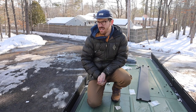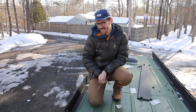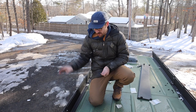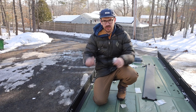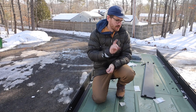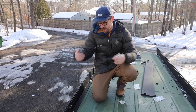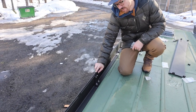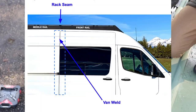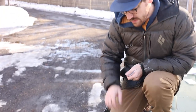Progress update: we've got the front fairing on, the sides are all loosely bolted down so we can still adjust things. A very important alignment tip — at least with our van — is this front seam, which should line up with the weld line on the outside of the van, which happens to also be the back side of the sliding door. We've put the mounting plates and brackets on which connect the two pieces together, all the way down the back.